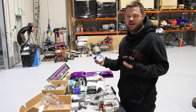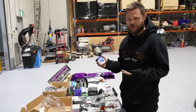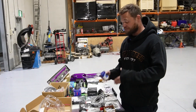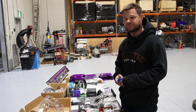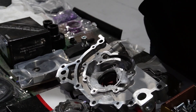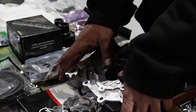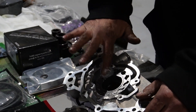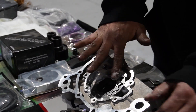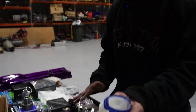The Vaseline was actually in front of me the whole time — it's not like we had to go to Woolworths. Two dudes going to Woolworths buying Vaseline is always an awkward time. So now we can actually pack the oil pump ready to put it on the engine. We'll grab the right gear set — these are our billet gears from PRP or Golby's. Now packed full of Vaseline grease, ready to pick up some tasty oil when it first fires, rather than running dry. Because no one likes a dry oil pump.